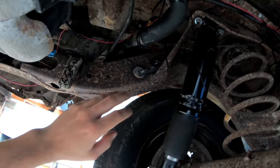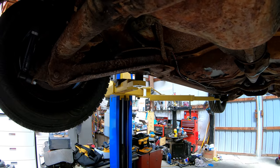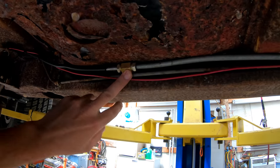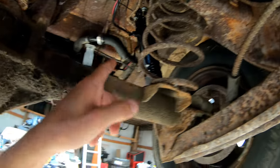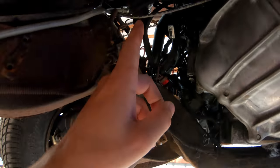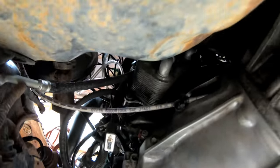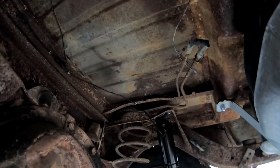Now for fuel line, obviously we didn't want to use rusty old El Camino fuel line, so we stole the factory fuel line for the Pontiac, and then we cut it down and unioned them together. So this was, you know, $10 worth of parts to make a 3/8 fuel line run all the way from the back of the tank and forward, union, bend. Obviously we just tweaked the bends a little bit here and there, and still have our nice flex fitting, factory fitting up there. I added air shocks. I think they were about $60-$70 off Rock Auto. Just so I'll be putting stuff in the bed, I want to be able to adjust the ride height. Those are the old fuel lines that we're not using anymore.